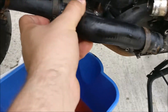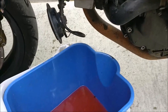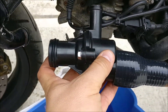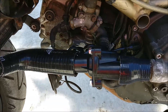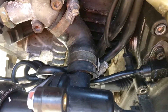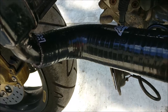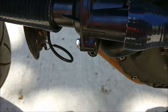We're now going to replace it — it goes here. Take that out and we're going to mount this, which is a fix. That's the original fitting into the overflow, a reduction fitting into the thermostat, and a 90-degree bend into the radiator hose. Clips and should be fine.